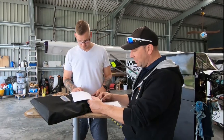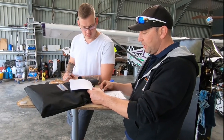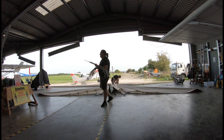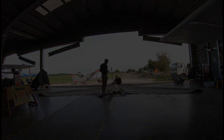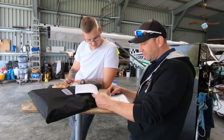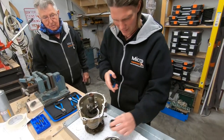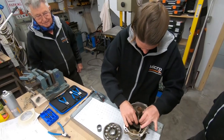As far as I'm aware, we're going in for a wing strip inspection. We're going to clean it back on profile and change the trim bridle upper and lower. We're also going to take the skin off and send it off to Top Flight Sails. Engine-wise, it's a standard 200-hour Rotax, replacing fuel lines and filter. We're going to inspect and look at replacing the cool lines. And we're doing a gearbox inspection — that's obviously just to remove what we discover in there.